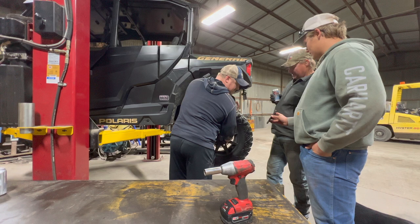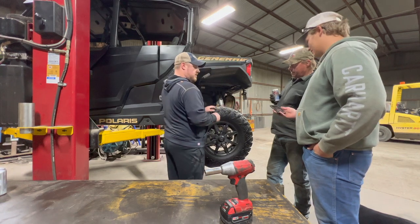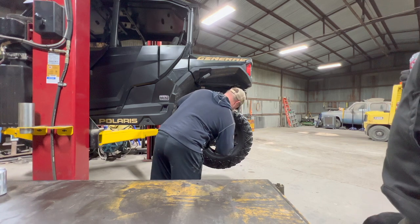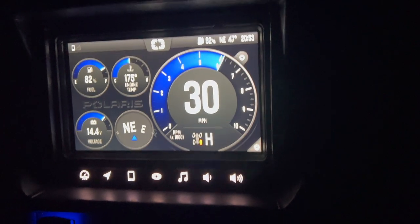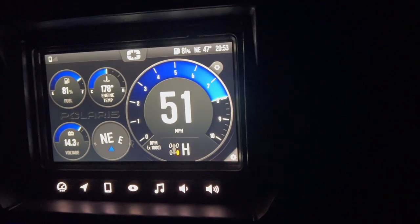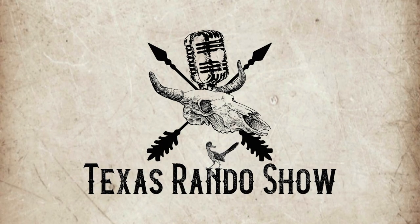All right, so now working through the reassembly — we have reinstalled both the clutches, the clutch cover, and the shock, and now we are putting the rear tire back on. What we found with the new Gilliman clutch is the RPMs dropped from 7200 to 6000 at 50 miles an hour — a 1200 RPM reduction. The machine is quieter, smoother, and feels faster. If you like this video, please let us know in the comments, hit that subscribe button, and we hope you have a wonderful day.